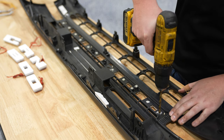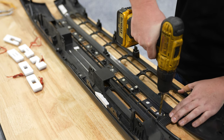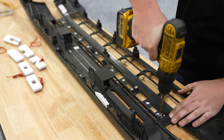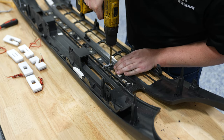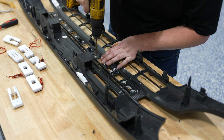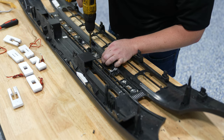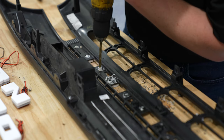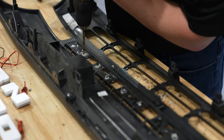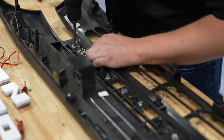Now you're ready to drill out your letters. Grab a quarter-inch drill bit and begin drilling out where the plastic weld is holding those letters into place. You should feel when the letter lets go of the grille — that's when you stop drilling. It gets a little messy, so have a vacuum handy once you're done.